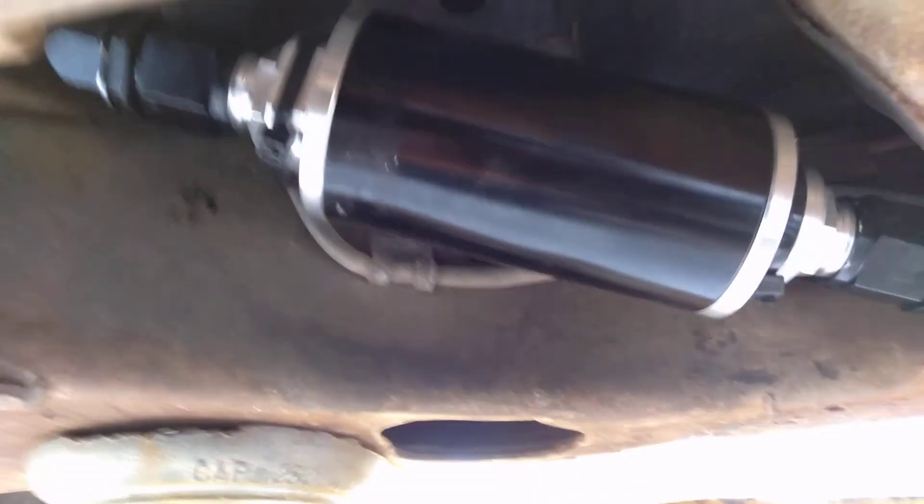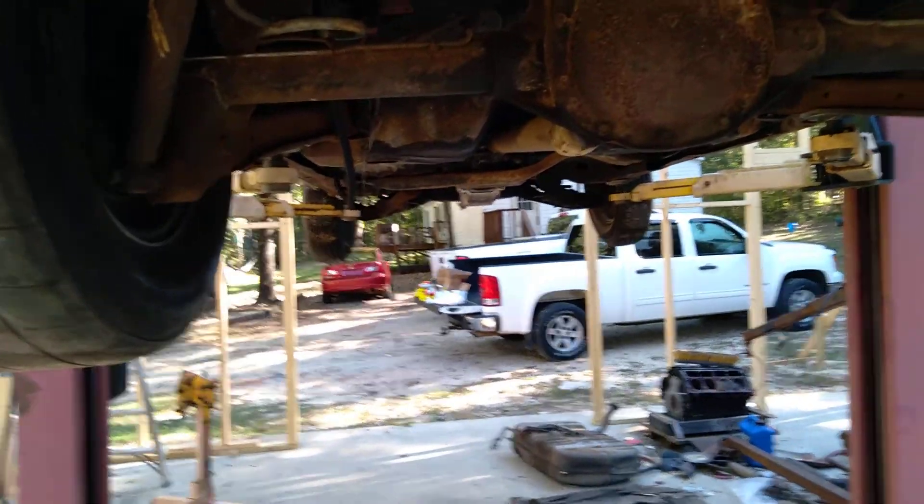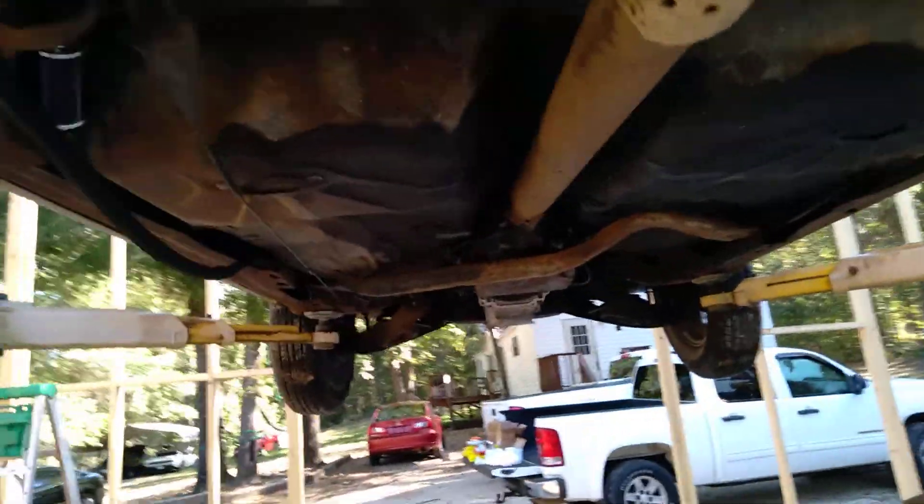It's got a brand new 350 — don't look like it, but that thing was built for horsepower. It tees off to two sixes, and this is some mock-up where I stuck it up there. There's a fuel filter, and then the tank's going to mount back here. I dented the floor so it'll fit without hitting when I bolt the tank back up — basically the tank's on. Two in-tank pumps in a stock-style tank. The chassis is not rusted out; it looks a little rough but it's actually in real good shape. I've already got a drain in the timing cover from another engine.